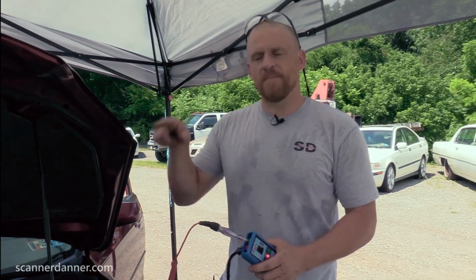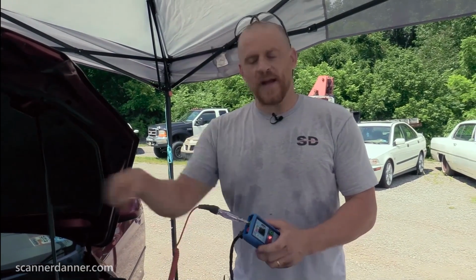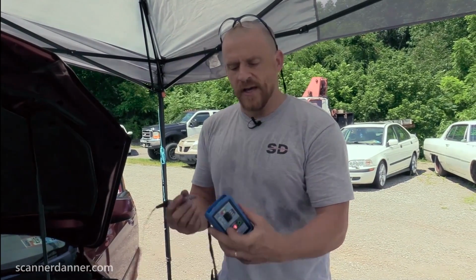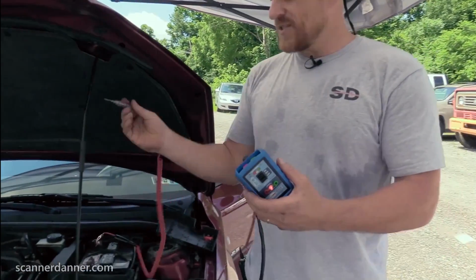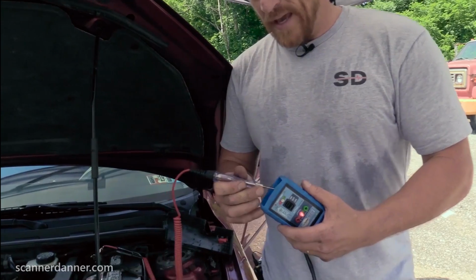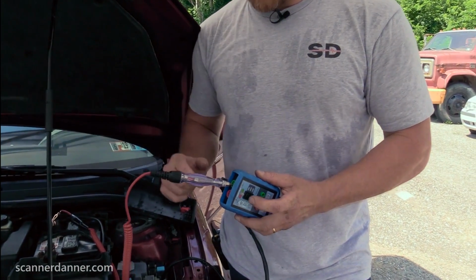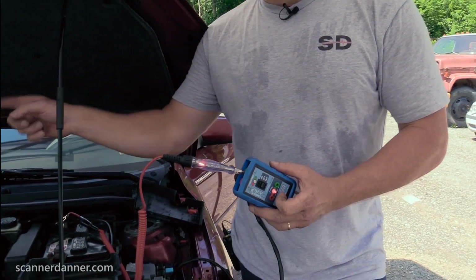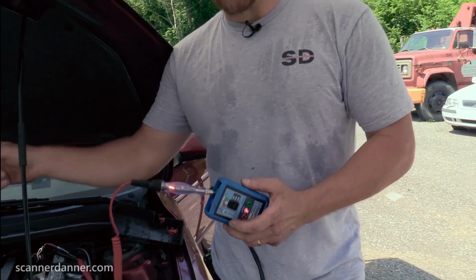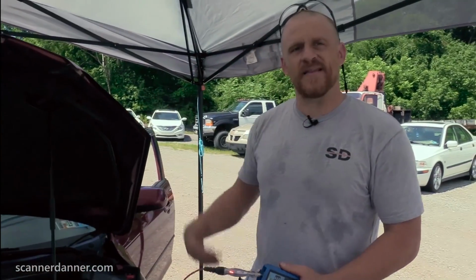What we need to do is a measurement down there. To see if there's still power. To see if there's power down there. So when I flip this to power and I'm gonna switch my test light back to ground, the last test we need to do and then we're done is on this green circuit, which is the load side feed down to that clutch. When I switch that to power, I should have power down there and ground. Check my ground. If they're good, we're done. We need a clutch. The last part of this is we got to get underneath this car.